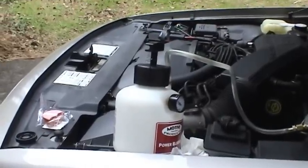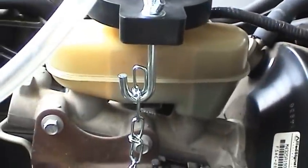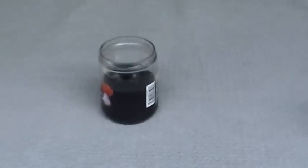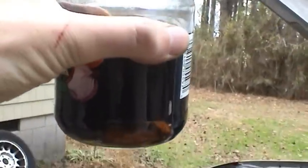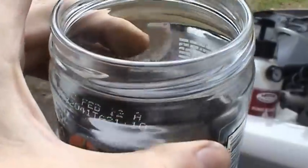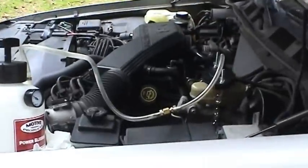This procedure is working out quite well — using this as a pressure vessel — and you can already see the fluid in the reservoir getting much cleaner. I'm still working on the right rear caliper and that stuff coming out is just as dark as motor oil. It's not as bad as it was on the F-250, which had 155,000 miles. This is 12,000-mile fluid but it's 17 years old — not a lot of particulate, but it's definitely worn out.